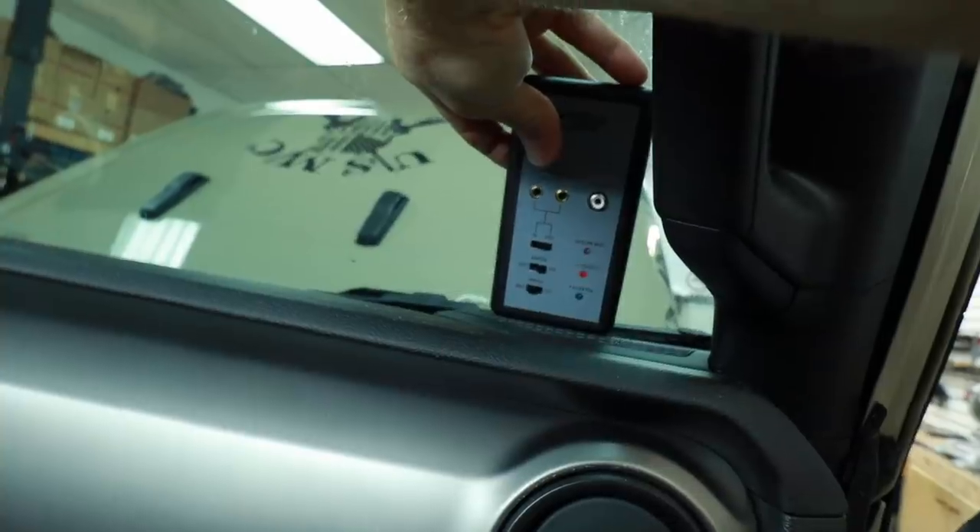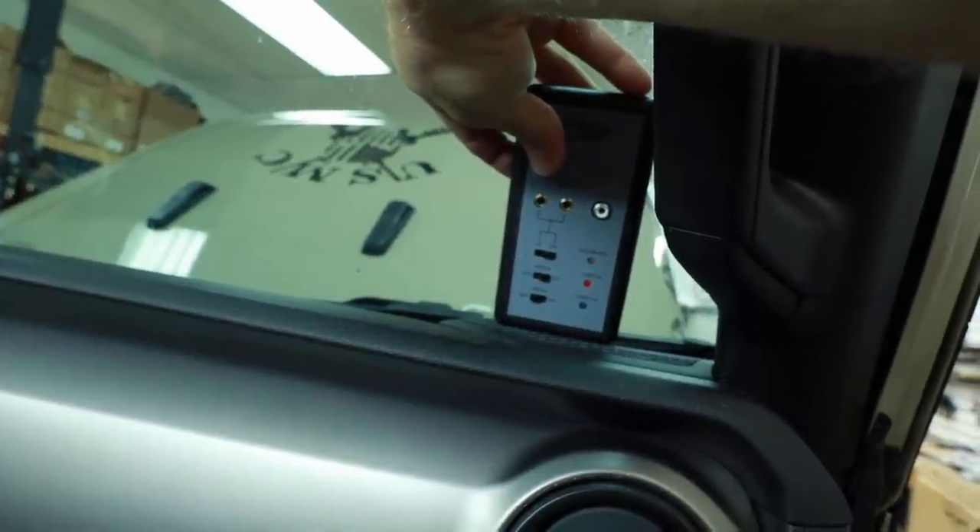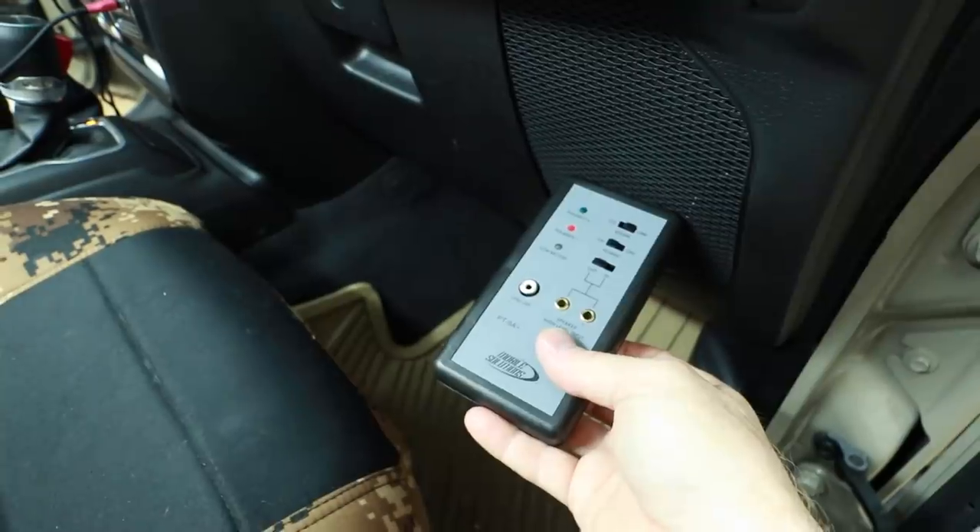One of the speakers comes up green — and there we have it. That's why we do those polarity tests. We know that all four of the speakers we're going to be replacing need to be red, and that passenger speaker over there that's connected is green. There are a lot of reasons why they may do that — primarily it adds spaciousness to the vehicle. It could be an all-pass filter on that particular speaker where the polarity pop reads as reversed, whereas the rest of the frequencies could actually be in polarity. That's a total possibility.